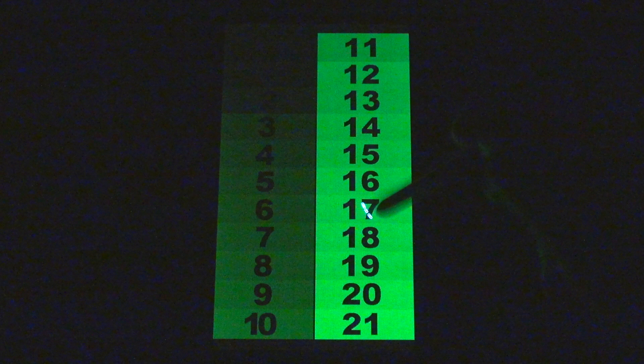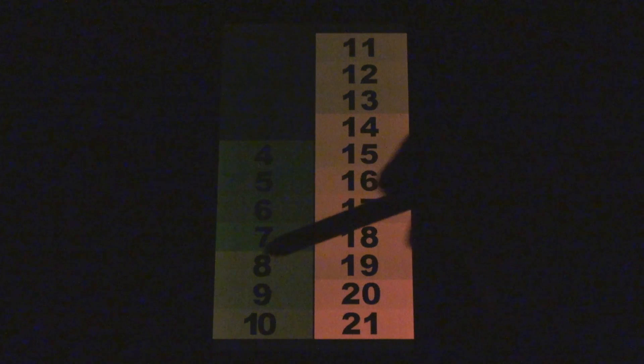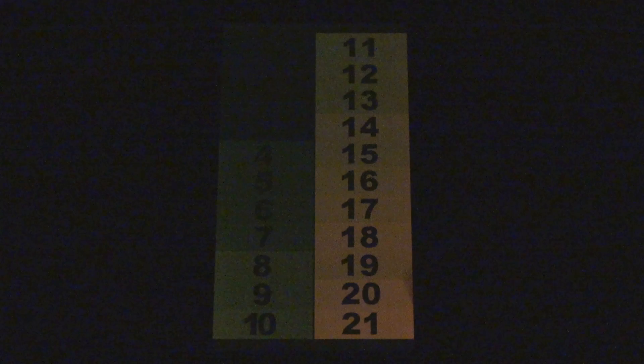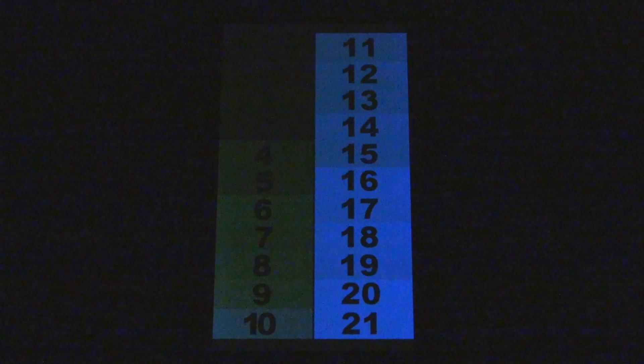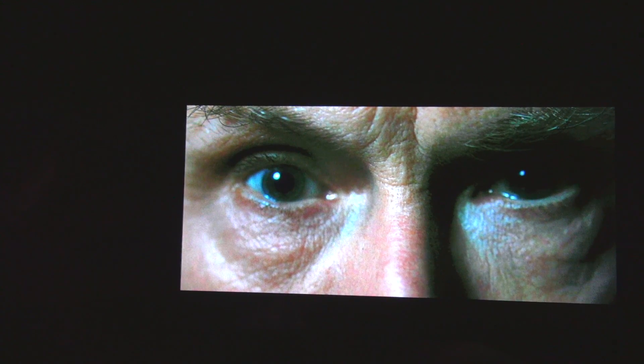I'm very curious to hear if you have different variations in those channels or any types of black clipping. The interesting thing about Samsung's display is that as you turn down the brightness, the color channels seem to lose their ability to display that particular color in the gradient. If you can see down here — it goes 7, 6, 5, 4 — when I turn down the brightness it starts to look more and more green, so it's losing its ability to show red. In this situation the green channel seems to be all right. But the same thing goes for the blue — once it starts getting to the lower end of the gradient, it starts to look almost entirely green until it hits black.